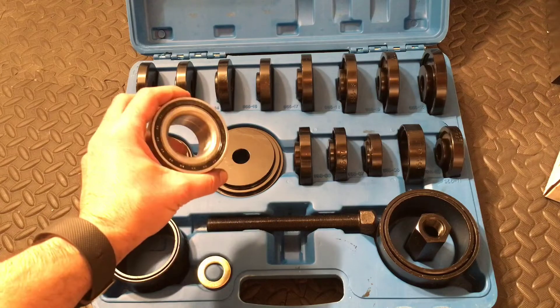You can see here inside of the steering knuckle. We'll go ahead and clean that up real good and then get ready to press the new one in. We've gone ahead and cleaned in here real good. We have the new bearing here — you can see how it lays in right there. So we're going to press that in, but first we're going to take a little bit of grease and do a very thin wipe around the whole thing, just to give it a little bit of lubrication to slide in there.